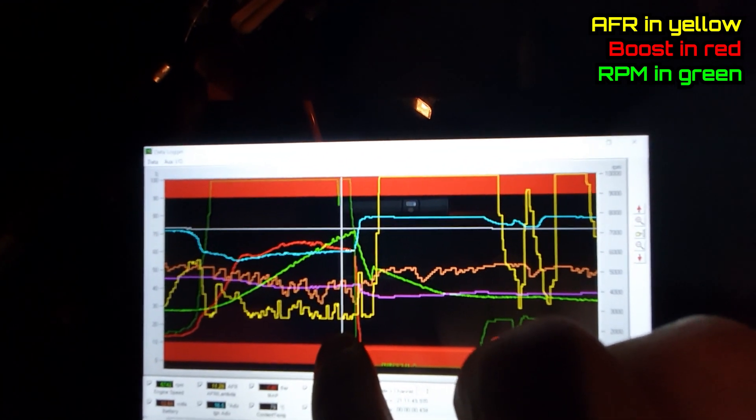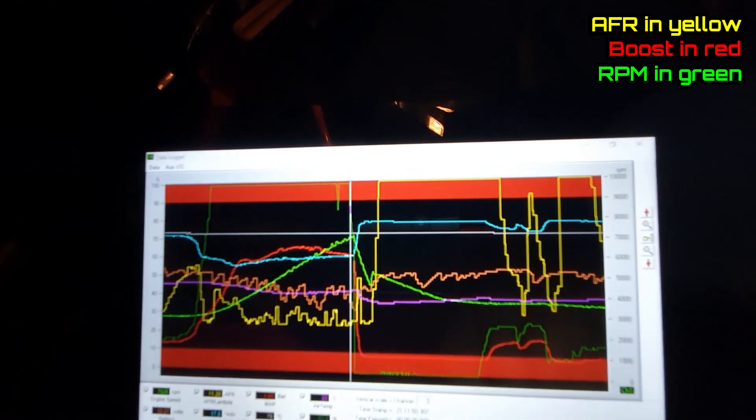Fuel is not wonderful but we are on Emerald, so don't expect too much. I am done for the night. We've made a little bit of progress — we've got it up to about 1.6-ish bar. Something interesting I've noticed: the 7 psi wastegate spring will not hold more than 1.5 to 1.55 bar at the very top end.